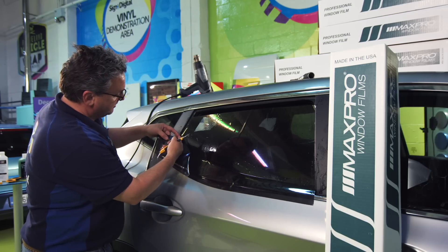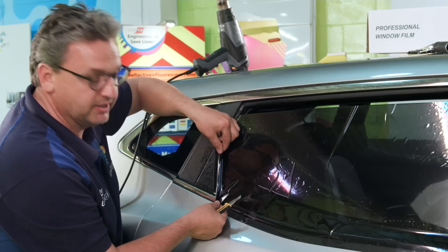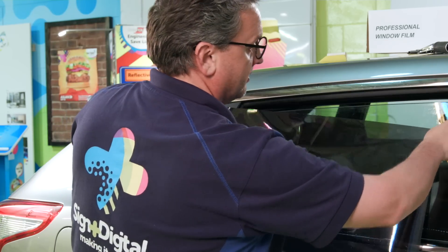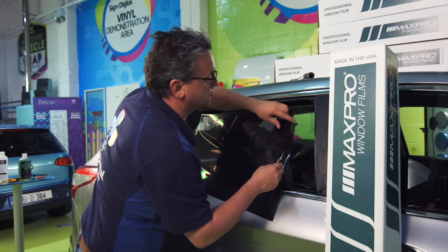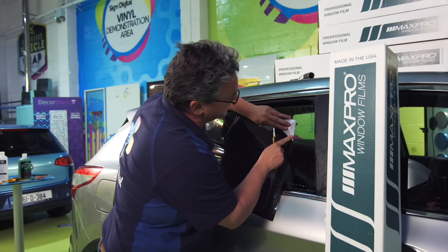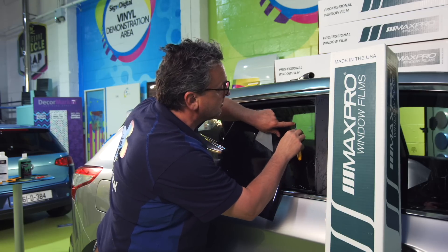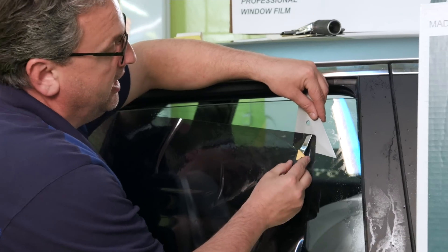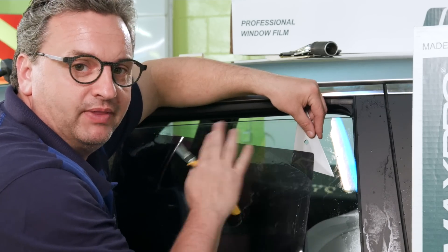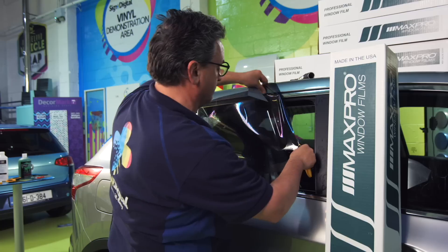This edge here lends out here and I have it down there, so I'll just take a little extra part. The fold I'm making here is for cutting when I've made my inside installation. Before I go in, I'll take the film off. Look at all the corners here — all the corners I have to trim one by one to make a straight cut. Again use your easy reach here. Nice straight cut, and it's up in the corner, using my nail, so I cut around my finger — because that part has to have a little curve. Because over the years, if we have a 90-degree angle here, it will slowly peel off, and that's not what you want. That part will not be visible, so it doesn't matter — make it safe so the job will last for the customer over a lot of years.